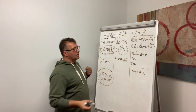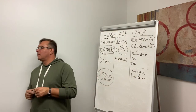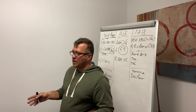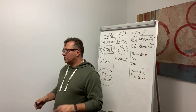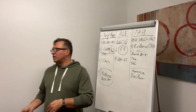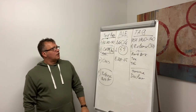And the last thing we do is a declaration. First of all, we declare that my vehicle didn't pull left or right, and it stopped smoothly, which indicates that my service brake is working properly. That concludes my air brake test. Put it in neutral, pull the brakes, and wait for the verdict. At this point, the examiner will tell you if you passed it. Okay. Questions?